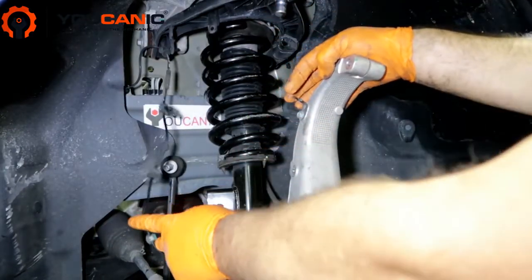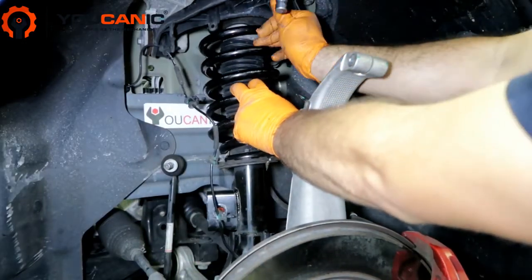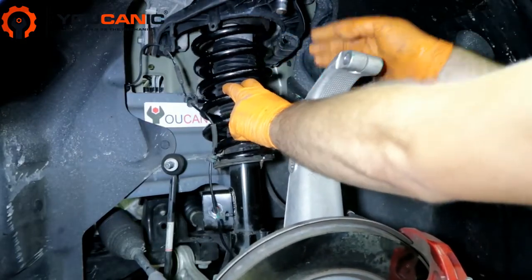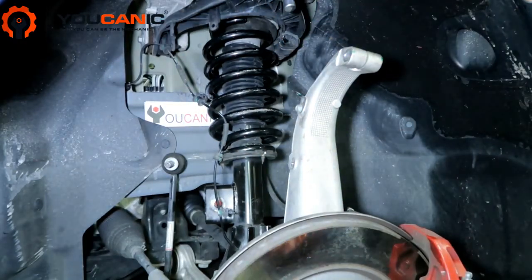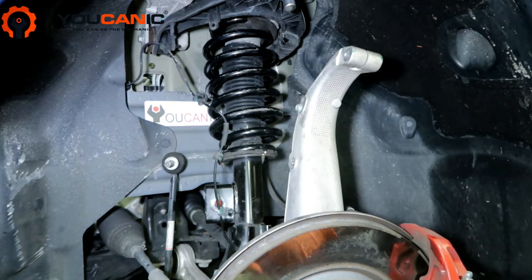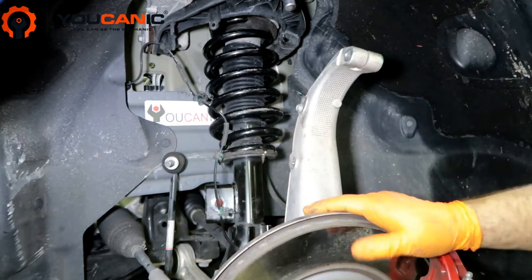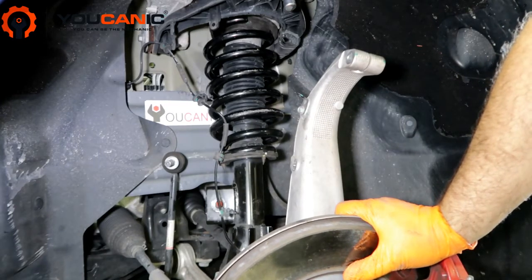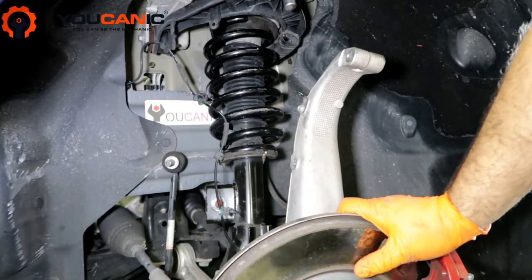You'll have enough room to get this out. It'll be a little bit tricky to get the upper part, but if you lift it up enough — maybe put a screwdriver between the two — lifting that up helps and then you'll be able to remove it. The installation is in reverse. When you jack up the vehicle, make sure to use the adapters so you're not damaging the hybrid battery. Also secure the vehicle with jack stands in addition to the jack. Make sure to follow our step-by-step instructions for more helpful tips. Thank you for watching.